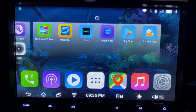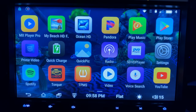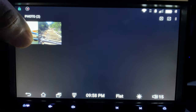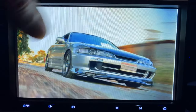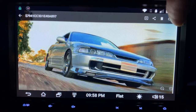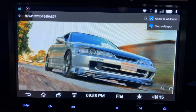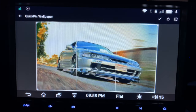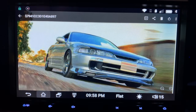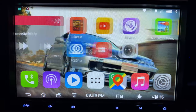Always keep a file manager app handy in case you want to add a new screensaver from a flash drive or install an APK. The quick pick button will let you find all your pictures really quickly and lets you apply your photos as a background. We'll go with the car photo — hit Set As and do quick pick wallpaper. It's going to want you to crop it, but let's roll with that. Still photos are probably a little easier on resources, but I'll probably switch between that and the live wallpaper.